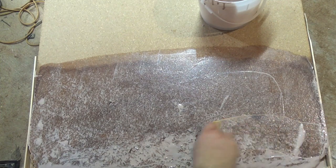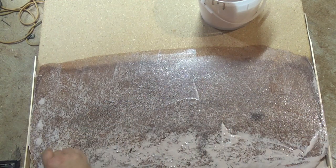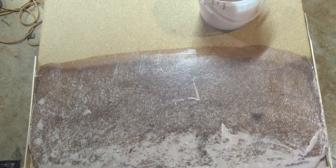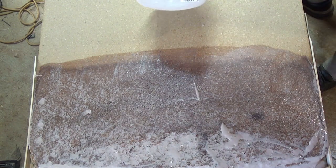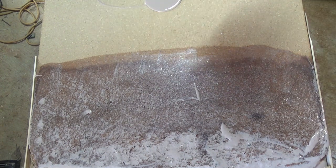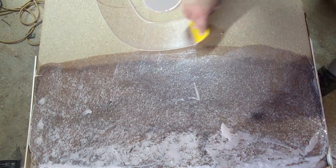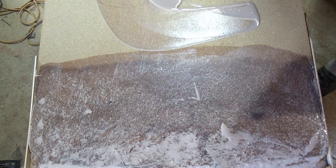Also, I don't know if you can tell or not in the picture, but I used some paint stirring sticks on the sides to keep the Bondo from leaking out the sides. So, just as an effort to smooth out the body, I'm going to go ahead and dump this stuff all over the body too. I'm going to go the lightest, thinnest coat possible. Also, this stuff will not harden as fast as regular Bondo does. It takes about 10 times longer. But that's okay. You come back in a couple hours, and it'll be harder than regular Bondo on its own.